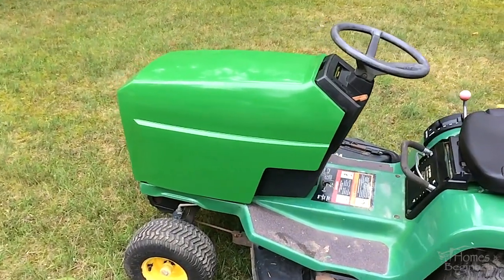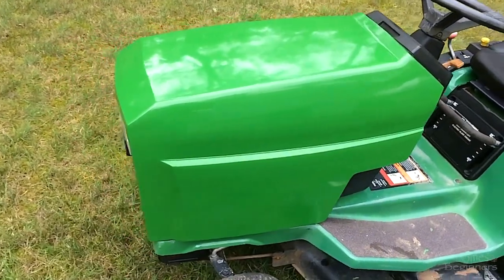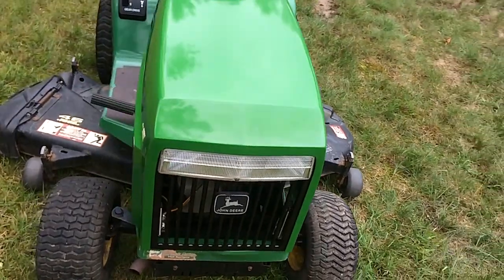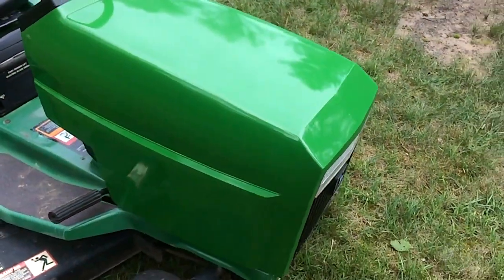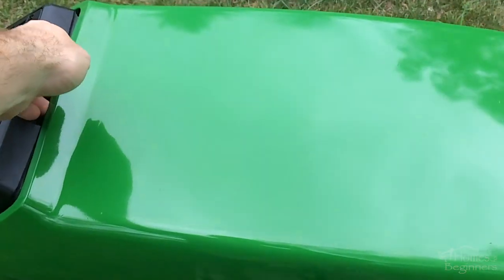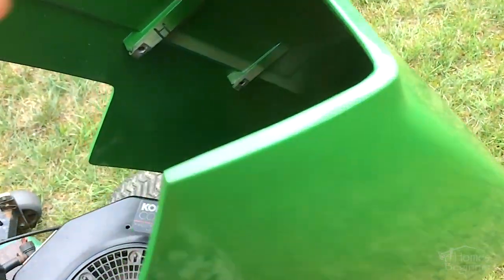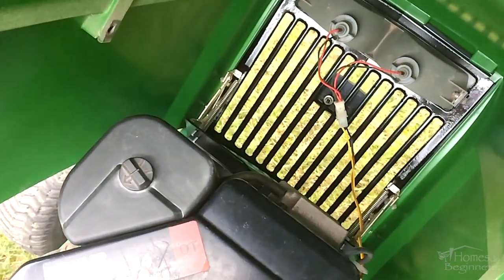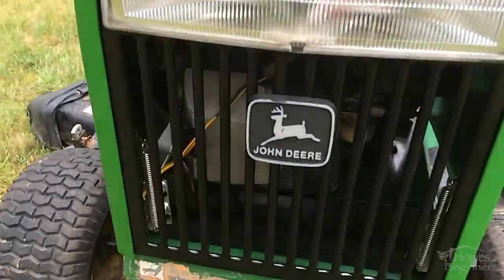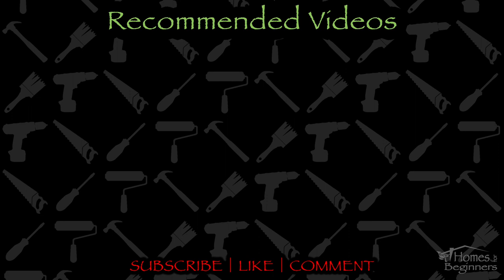I also painted the grill and gave the rest of the body a quick polish. Once done, you can see the final finish. Decals can be installed if you wish, however I would let the paint cure for at least a couple of weeks before that's done. Both on the inside of the hood and through the grill you can see the hinge setup, which is completely different than what was used from factory — I used spring-loaded stainless steel hinges purchased online and mounted them to a steel plate. If you found this video helpful please don't forget to give it a like and drop a comment below. Don't forget to subscribe to my channel for more home DIY videos. Thank you for watching.